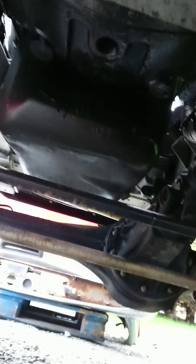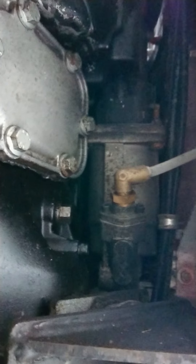Got the Cummins engine SAE bell housing onto the ZF box, running a Clutch Fix HD1 clutch. And there's the air assisted slave cylinder over there. This thing's bogging and doesn't need a wash underneath, but there's the air assisted slave cylinder.